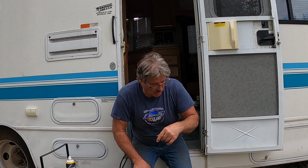Well, then I've got this little $5 multimeter that I'm using, checking stuff with. So I decide I'm going to start checking the fuses in the fuse box, even though sometimes when a fuse looks good, it's not, and you think it is, but it's not. So I start checking the fuse on top of the spade type fuses that I have. Here, let me show you what I got.